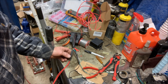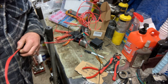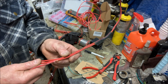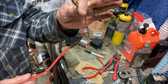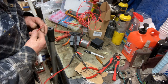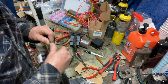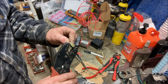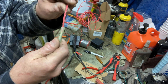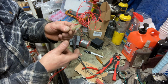The two yellow wires, which are hot power in from the battery, I used butt splice crimp connectors with heat shrink insulation to attach to two 10-gauge wires from another harness — that end will go to the battery. And then the two red wires are going to go out to the fuel pumps, one on each. I'm going to extend those wires using crimp connectors, hit them with a heat gun so it shrinks down for a weather-tight connection, then put shrink tubing over that as well.